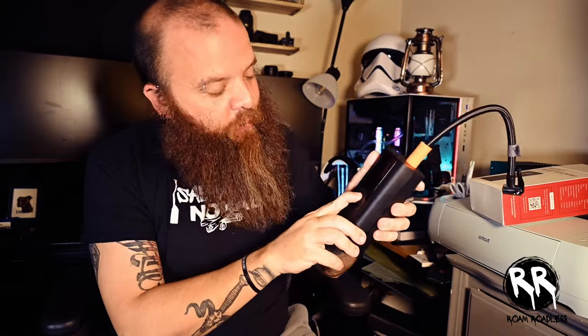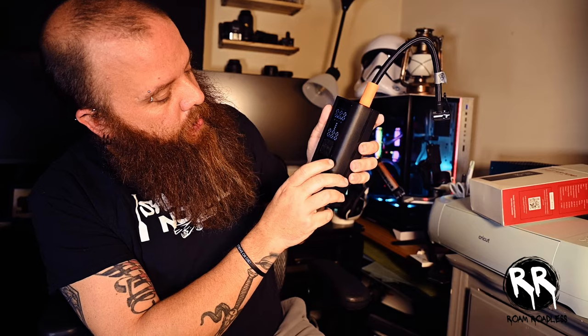No more fiddling with complicated setups. The quick connect air chuck is a total game changer. Just screw the hose into the pump, press and connect the chuck into your tire or ball — really whatever you're blowing up — lock it into place with this lever and you're good to go. Then press and hold the power button. It has up and down arrows so you can change your PSI. Press the power button again to give it the go-ahead, and it'll stop pumping when it reaches your target. I'll give you a real-world example — I'll go to my car, deflate the tire, and blow it back up to show how long it takes.